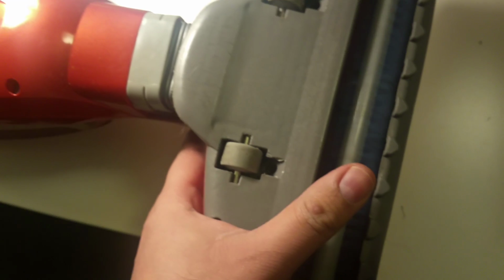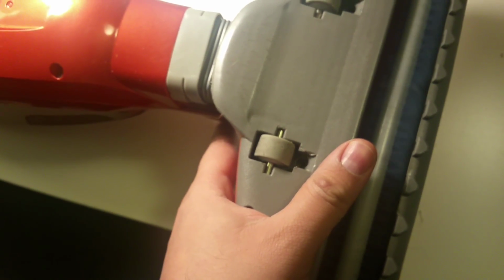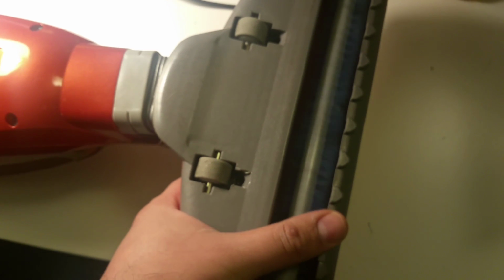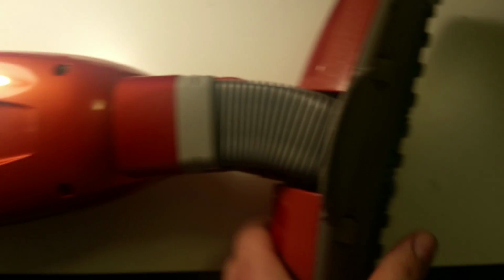And it completely filled the canister with dirt. And I had just vacuumed twice because I discovered the roller being powered at 7 volts on the low setting versus 6 volts on the high suction setting, which the 7 volt low power setting actually worked better. And so that's what caused me to make this mod here. Even if you're grinding up against something, it does an amazing job. And that's the gist of my Ergorapido mod.